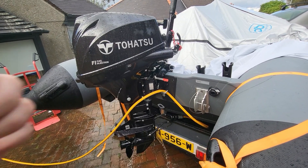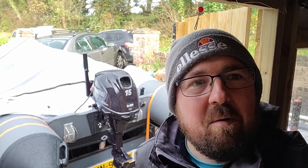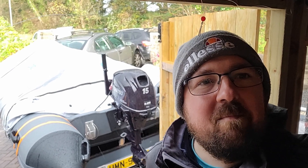It's just started raining, so this is a perfect time to get wet anyway. Let's give it a start. So that was it — changing the ECM and removing the restrictor on a Tohatsu 15, one of the EFI models, and replacing it with the ECM for the 20 horsepower of the same series. Engine's running, sounds good. I look forward to seeing how well that pushes the Scout along next time I get out. If this video was of any use to you, please hit a thumbs up and subscribe — it gives me every reason to continue making more videos. Thanks, see you soon.